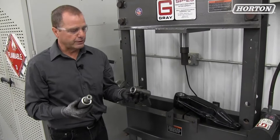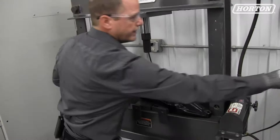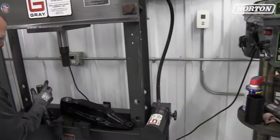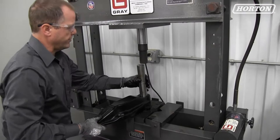Before we do that, we'll make sure that we lubricate everything. It's always best to put some lubrication — I like WD-40. We'll lubricate the bore and we'll lubricate the bushing. Zach's going to help me again with the press. Just make sure we get everything lined up. We'll have to put our receiver tube underneath because the pin's coming through.